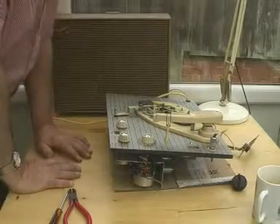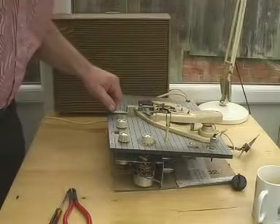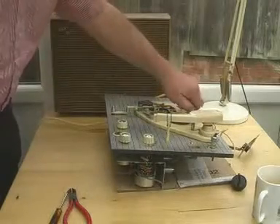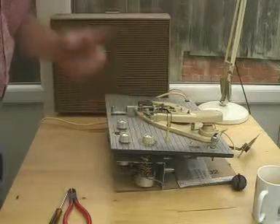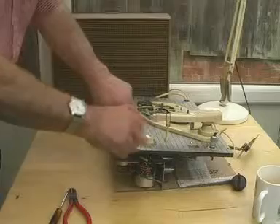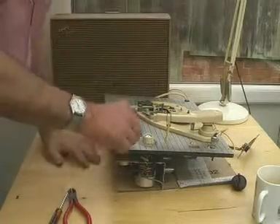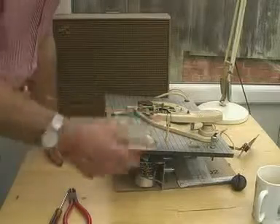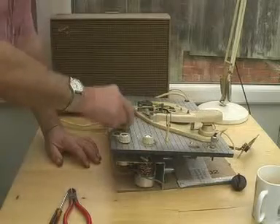The motor hasn't started to go around — we can just twirl it to see. There's a switch there for the motor which is not working. But if we move the selector switch — listen, there's something there, there's a hum. Operating the selector switch: G, which I presume is gram; B; PB is playback obviously; and the other must be record. The amplifier sends out to live.